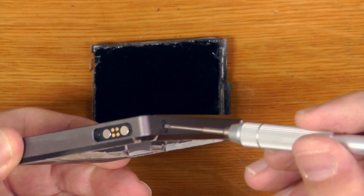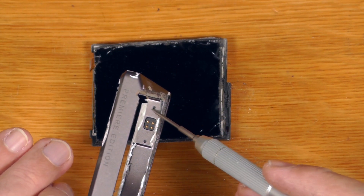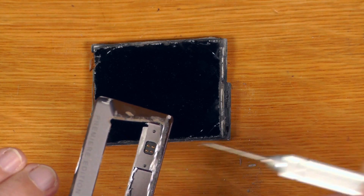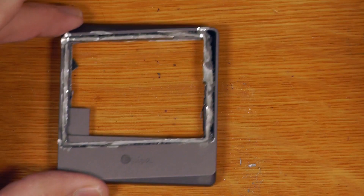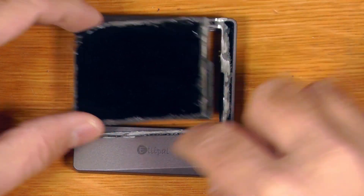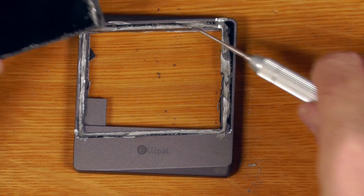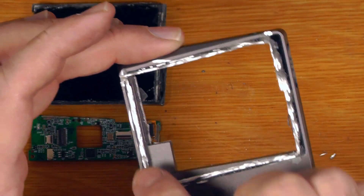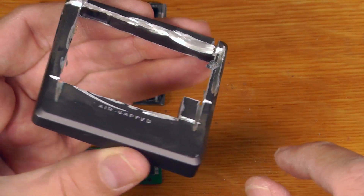You can see that bit that stuck out — that's the metal frame. The power button just pops out now. This magnetic charging thing here just screws into the metal frame and connects through four spring-loaded connectors onto a pad on the board. In the factory they'd start with the metal frame, put these components in, and then this whole thing would just shove in there and glue down to the front. Unless you can get the glue around the edge to let go, you can't get this thing out intact. The bottom part is solid, with a thick frame around the edge — this explains those videos where they run over it with a car and it's pretty much fine.